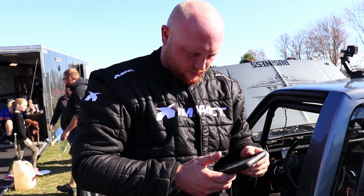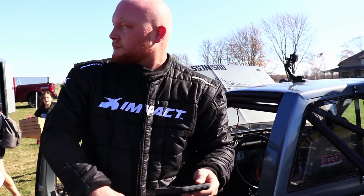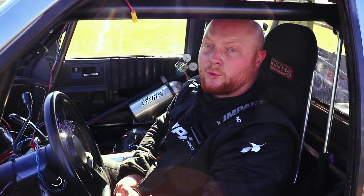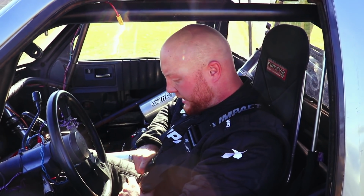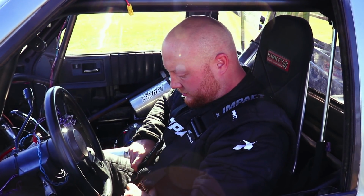And 113 to 172 60-foot time. Tightened up the front even more. That turned down total boost a little bit because we were maxing out the injectors that run, so she went a little bit lean. Nothing to be worried about, but until we get another pump on it, just play it safe, because we're really just working on 60 anyways.